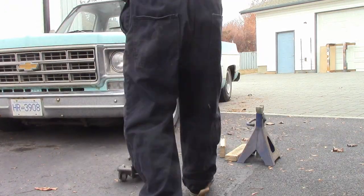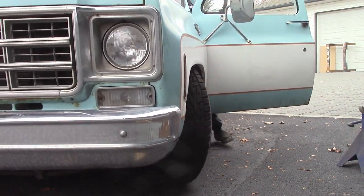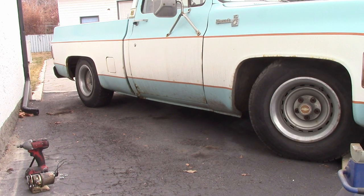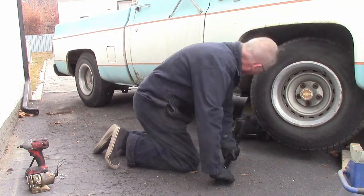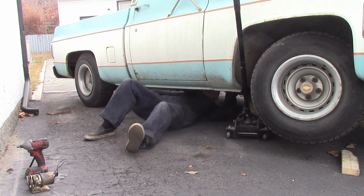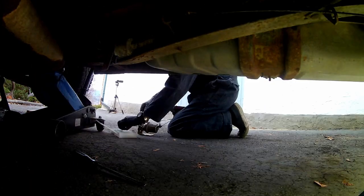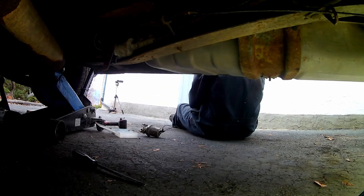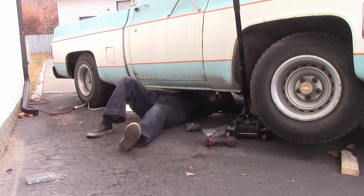It's spring, it's about three degrees outside, and here we go. First, we're just going to push the vehicle further away from the house. Since I have no friends, it takes a fair bit of work, but it's downhill so it's not that bad. Then we're going to get the floor jack, and I have a couple blocks of wood to keep the vehicle from going over. I'm going to throw a jack stand under there so I don't get squished. Then I have a good look at what I've got here, and I'm removing the EP12S pump. You'll notice the other pump in the background in preparation of putting it in.